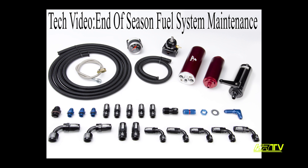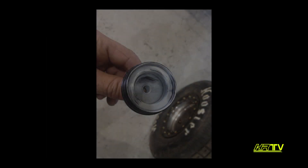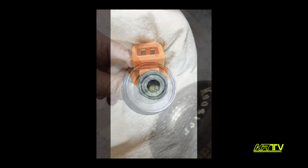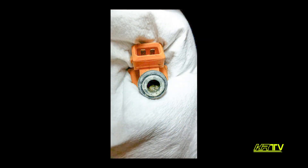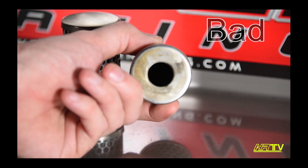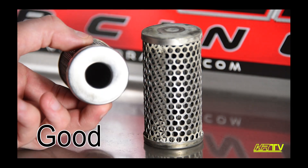At the end of the race season, it is very important to get all the methanol out of the fuel system components. Methanol alcohol will destroy aluminum fittings and the fuel pump and regulator. It will also deteriorate your fuel bladder and fuel lines. The corrosion occurs when methanol is combined with oxygen and left in contact with the fuel system components. Fuel filters clogged with a black film is from the deterioration of the tank bladder and fuel lines.